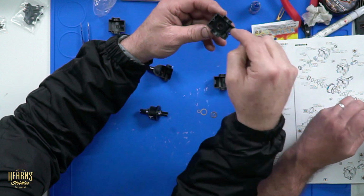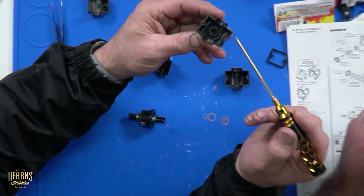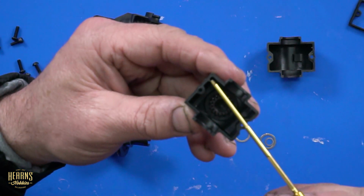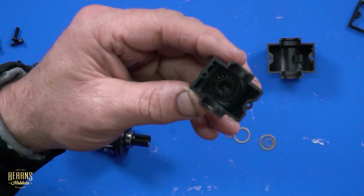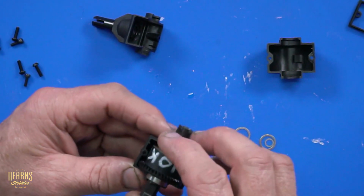In the rear gearbox case you've got a little... Let's zoom in. Let's show the punters what's going on here. You see this little tab here? I can see the tab. It's a little dimple in the casting of the case. That's the side the crown wheel doesn't go, so you can't put it in backwards. You should not. So you drop it in.